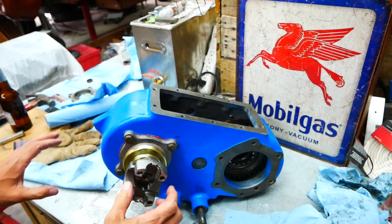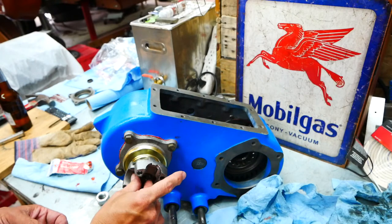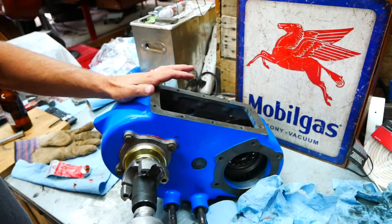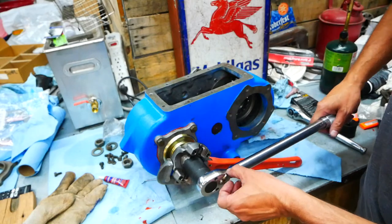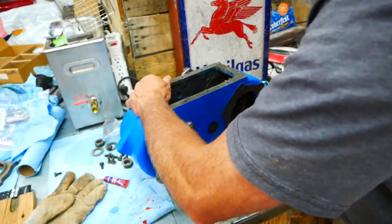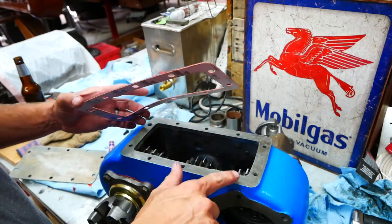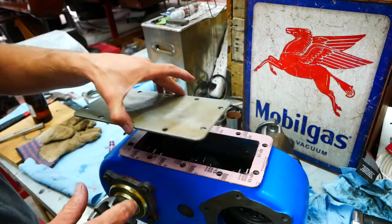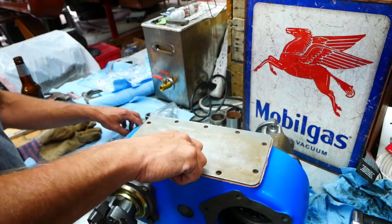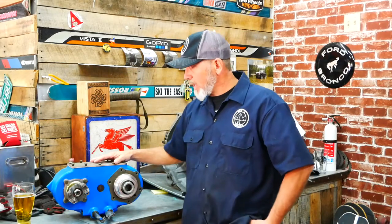We're going to tighten the front drive shaft yoke — slid the yoke on there. Similar to the last drive shaft yoke, put some RTV on there and slide it in. Run this up to 125 foot pounds, slowly at a low angle. Then the second to last thing is to put some gasket maker on, put your gasket on, gasket maker again, and then put on your bolts. I'm not going to do that to mine right now because I still have ways to go on my build. All right, our Dana 20 is rebuilt.